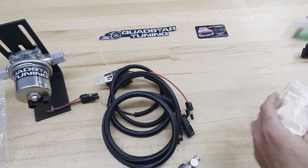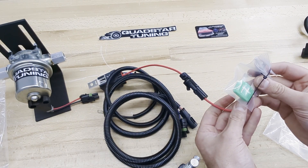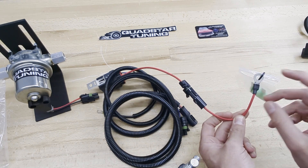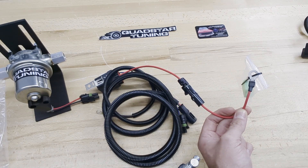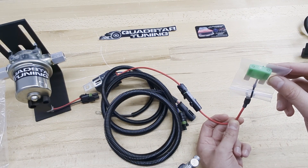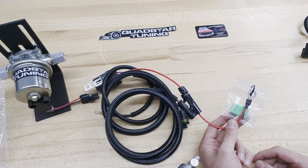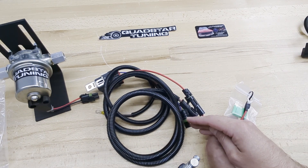If you have a 1995 or newer truck, you'll get this style connection — it plugs in and adapts to our relay. This goes to your under-hood fuse relay center or fuse box, on the driver's side, and connects to an auxiliary lug on the outside of the fuse box. Just take the nut off and attach it. If you don't have a fuse for AUX A or AUX B, we include one — otherwise keep it as a spare, since some trucks didn't have that if they lacked factory trailer brakes.